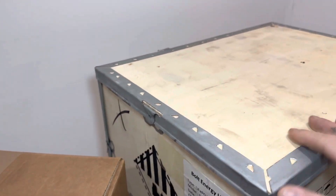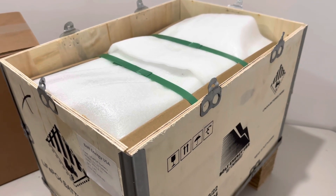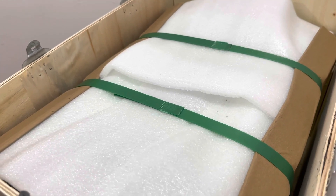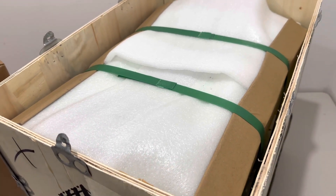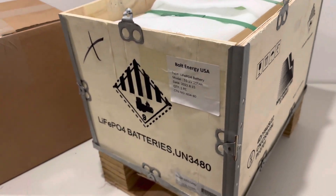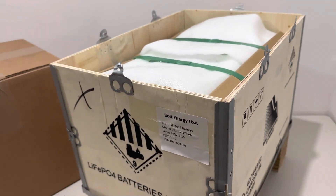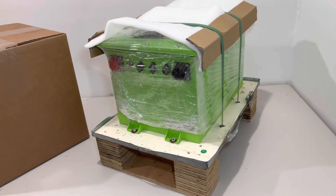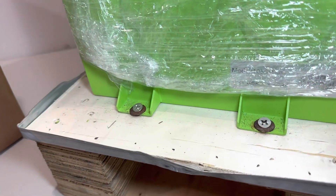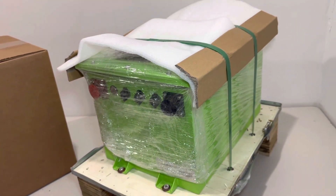We're going to disassemble this box. Once you pop the lid on the battery box, you will find that the battery is pretty well encased inside with styrofoam and some thick cardboard — it's banded nicely. Next you'll pop the bottom tabs, which will expose the battery. Once the box is disassembled, go ahead and remove the four mounting screws — they are Phillips head — and take the bands off to get the battery fully exposed.